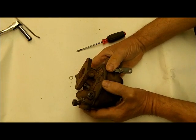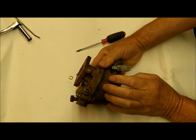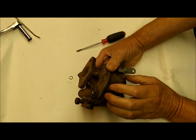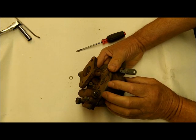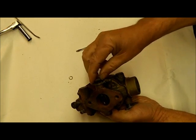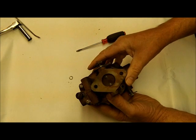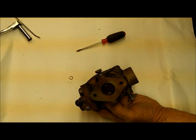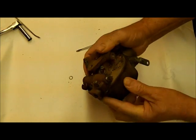That's a very popular kit for these. For tractor types like this — Oliver, Allis Chalmers, whatever it is — we have tractor kits also. They're pretty good kits and more complete; they come with a new throttle shaft generally and a lot of times a new choke shaft. Throttle shafts get very specific, so the kits have to be very specific for certain tractors.